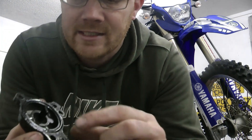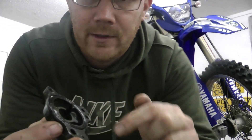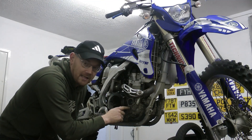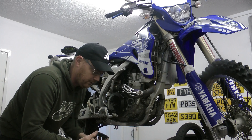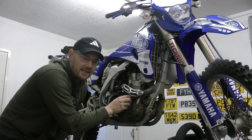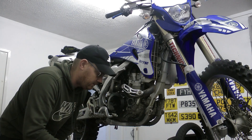Now when you've got this case off, it'd be ideal to replace the o-rings. There's an o-ring there which seals the main body of the filter, and there are also three o-rings here which cover all the oil galleries. Make sure they are either replaced or inspected and checked. Refit your oil filter and fit that back up. Do the bolts up — don't over tighten them, just nip them a little bit until they go tight and then just a touch more. Otherwise you run the risk of cracking the case or pulling the threads.